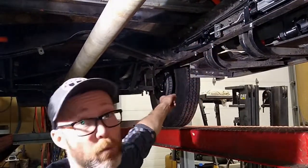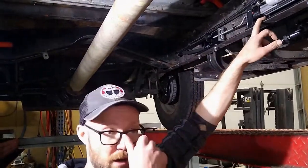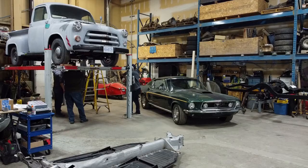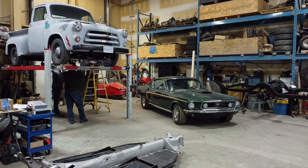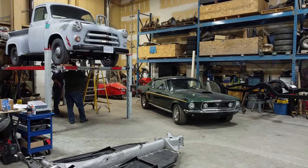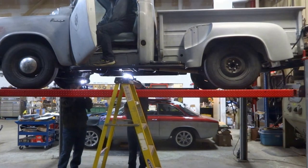You want enough force to hold the vehicle but not snap the cables. We have a chip inside the truck where we can dial in the number of amps the actuator motor receives. Once there's enough tension on the cables and it hits that amp limit, it shuts off power to the actuator and it holds. Right now the park brake is set — this truck's not going anywhere — but Doogie's going to switch it off so you can see the actuator working.